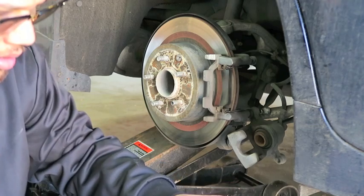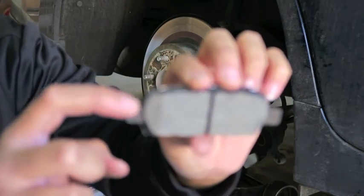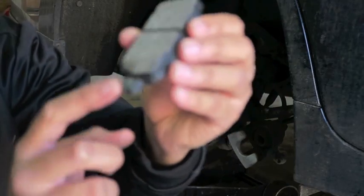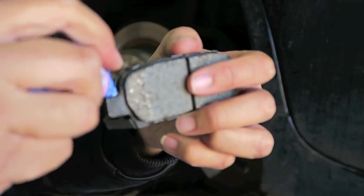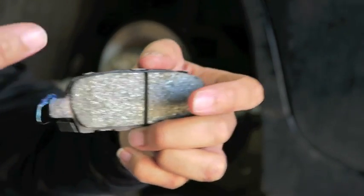What you want to do is put grease on the edges right here. The reason for the grease is for protection — usually when you have metal-on-metal surfaces, it's a good idea to have lubricant because of the friction and heat it causes. You want to grease these surfaces so there's a nice smooth transition into the metal sleeve, so you don't have squeaking and noise that you don't want. Just a little dab on the edges — do not put it on the surface itself.